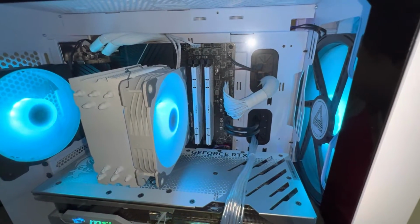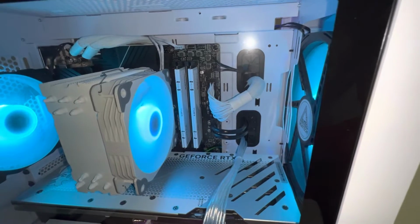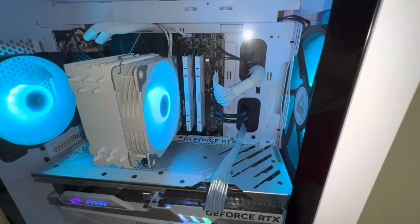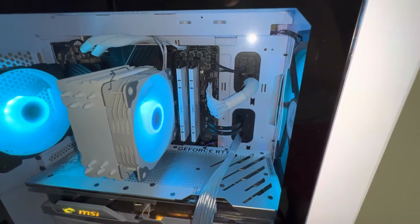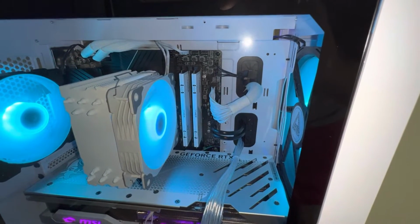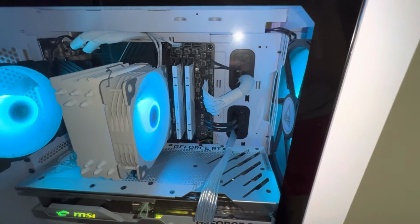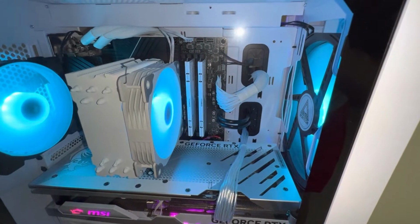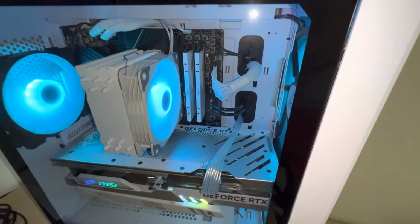This isn't probably the optimal way to do this, or maybe it is, I don't know. I didn't get a chance to try what would happen if that hub worked correctly because it was never working correctly. So I'm gonna see if I can find any Montech support forums or something that might shed some light on why it's doing this. My BIOS has the latest firmware updates and things, so I don't think it's the BIOS. Clearly the fan ports themselves are working because it's now controlling the fans, but for whatever reason, the hub and the motherboard aren't talking together correctly for fan RPM, and I wanted to make sure that the motherboard could adjust the fan speeds based on temperatures and things that it needed to, and have control directly over these fans. So that's how I solved the problem.